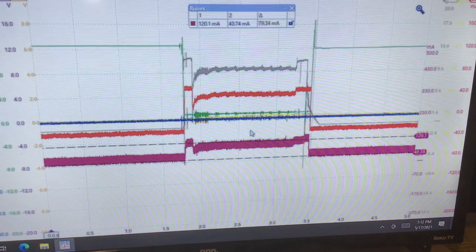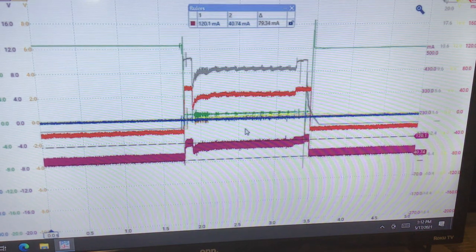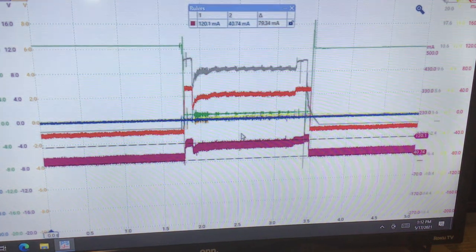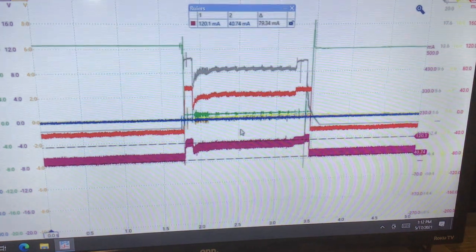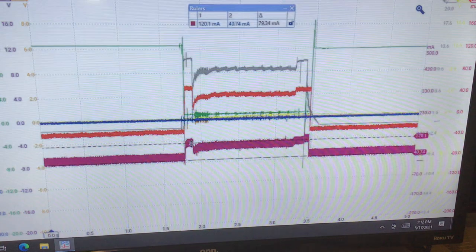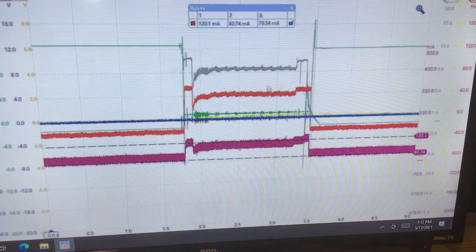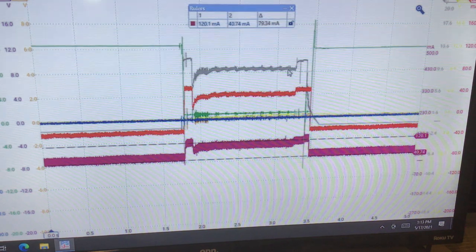As you look at your schematic, it'll make sense, because it's the same series circuit coming from the ignition coil relay into the PCM driver. That would latch the ignition coil relay and, of course, power the ignition coils, as you can see on the schematic. But obviously, we have less current flowing through the burgundy channel than we did when we had the system running normally, when both relays were closing. So anyway, I just wanted to show that, so we have some validation about the current flowing.